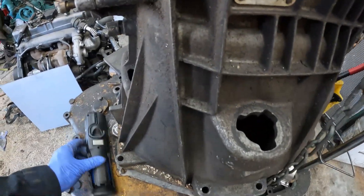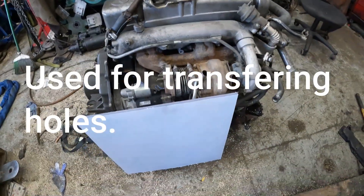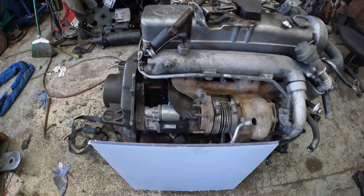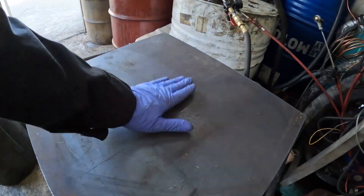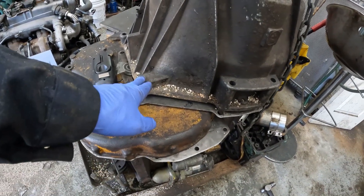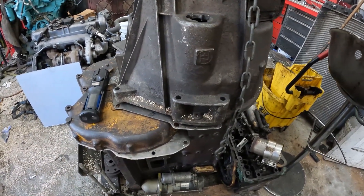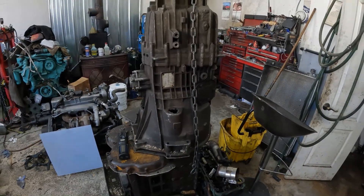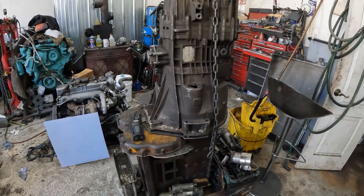To make it easy, I bought a piece of clear Plexi that's 3/8ths. So the adapter plate will be 3/8ths and the spacer about a half an inch, roughly. I also purchased a half and 3/8ths plate steel. The ZF6 does not fit this Deere housing, so we've got to make the adapter plate and make it all as one so this transmission is solid. And therein lies the challenge. Let me pull this off and I'll show you the adapter I made and the processes I had to go through to do that.